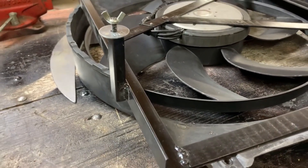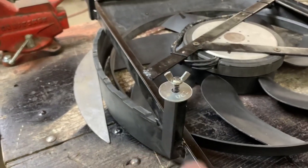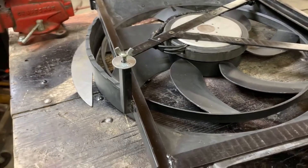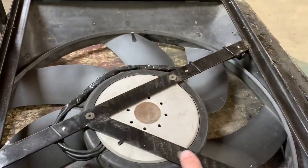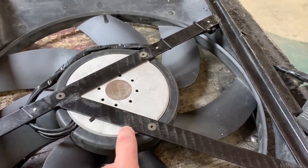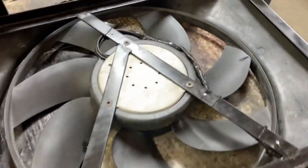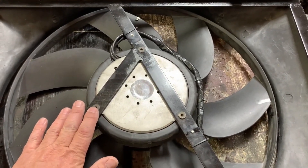After the aluminum radiator sits on the frame rails, I put a couple of pieces that go up and engage the core support. It's not perfect but it works really well. I put a couple of cross supports in a way that they line up and engage the factory Mercedes fan — drill and tap a couple spots on the mounting ears of the fan — and it works just fine.